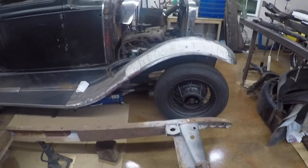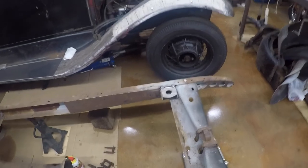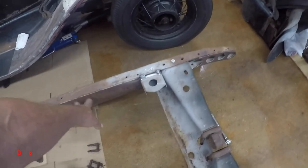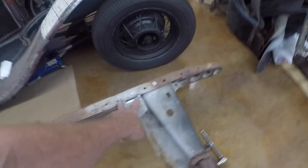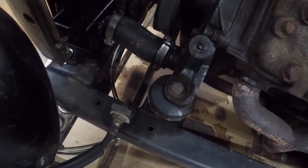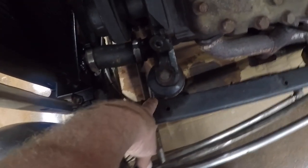So I just remembered: push them all the way forward, as far as you can get them. But these backing plates — I did not put these backing plates in here. The backing plates have got to come off the motor mounts. I just tacked them, luckily, and I've got to move them back. I'll take the measurements off my roadster. You can see that cross member has been cut, and you can see how far back that motor mount is.